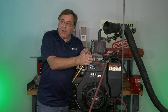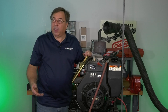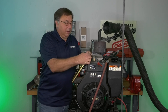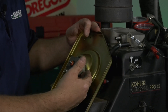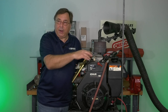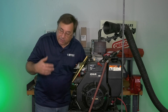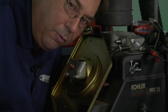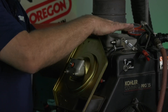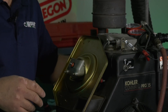Another area to listen to is through the air cleaner inlet. I put my ear down on this one and I can actually hear air coming out. A lot of people will just stop right there and say they've got a bad intake valve leaking. Don't forget your breather tube attaches to the clean air side of the air filter. I'm getting air out through my breather tube naturally. I need to make sure I remove the hose from my breather system from the engine's breather outlet — otherwise you'll get a false reading that the main intake valve is leaking and you'll go in the wrong direction.